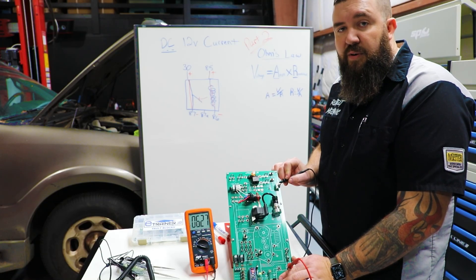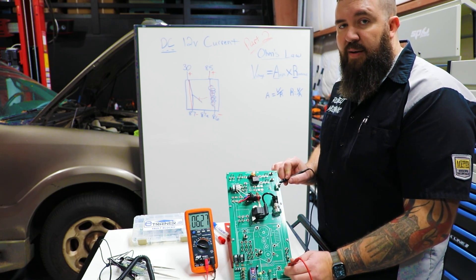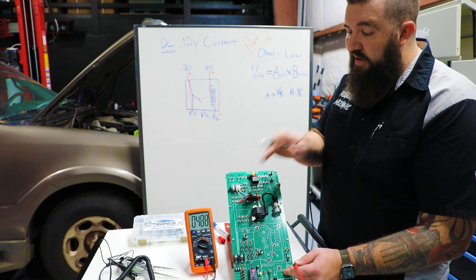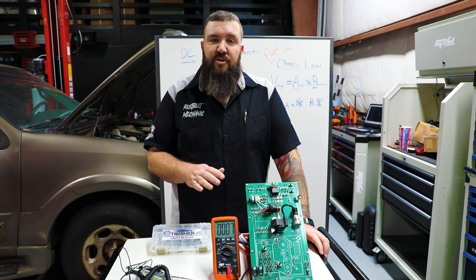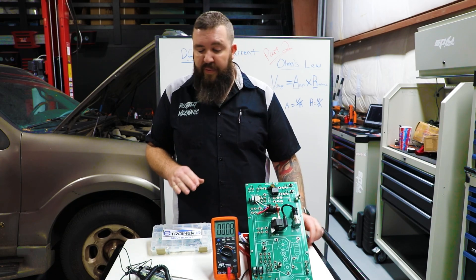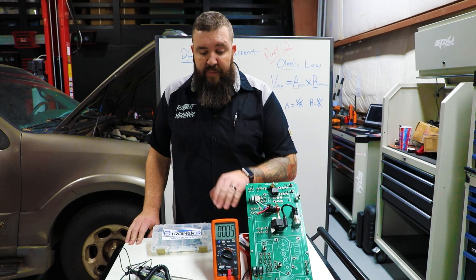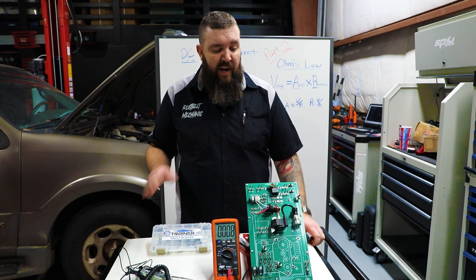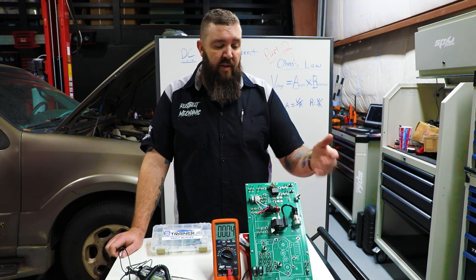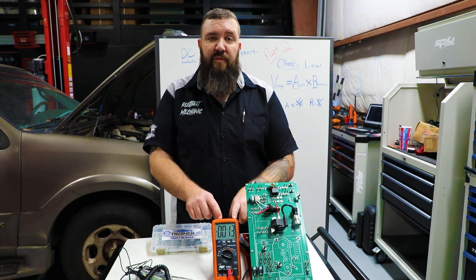Like with that window motor circuit, high resistance may not even be able to power it up at all. Checking voltage drop is the best way to check a fully functioning system, compared to using a test light or using the ohms setting on your meter. The voltage drop reading gives you an actual value shown as a voltage drop on your meter — that is always going to be the best way to test a questionable circuit. If it's questionable at all, always use the voltage drop test.